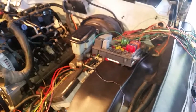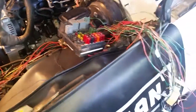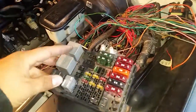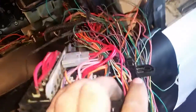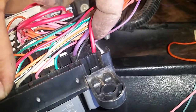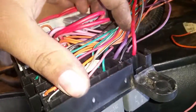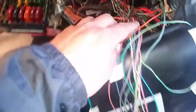I wanted to show you on this truck: if you strike the key to start the truck while the engine is already running and you strike the key again, you're going to get grinding on the starter. This is the starter relay right here. On the back of it we have the purple wire, which actually feeds power to the starter, and this red wire is coming from one of these fuses. This same purple wire goes through the loom and makes its way down into here.